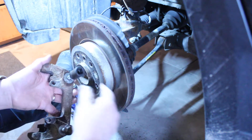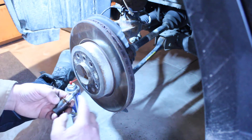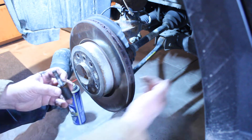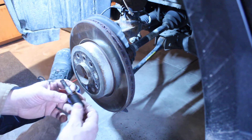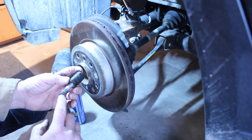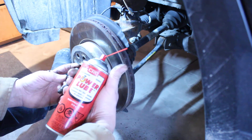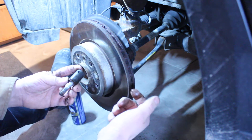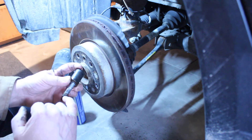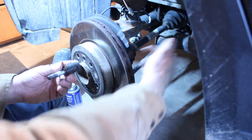5/8" fits perfectly - in fact there was a bit of a rust haze on the outside and I almost had to drive it on with a hammer. Something I've talked about before: when removing bolts that go all the way through, notice the outer tip of this bolt is rusty. It passes all the way through the steering knuckle and protrudes out the back. So when you go to loosen it, you'll crack it and get it started, but then you'll have a little button of rust on the end. Sneak some penetrating fluid in there, loosen it a couple of turns, put it back in, out a couple, back in - work it back and forth, because that whole surface has increased in diameter from rust and you've got to drag it through its threads.